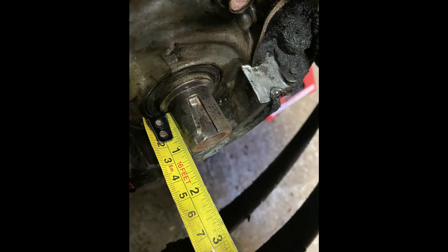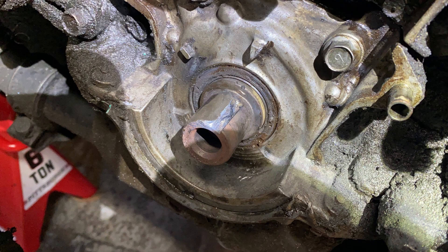I just want to show a picture of what the crank looked like right when I got it, when I took it apart. Starting by fixing this — I had nothing really to lose — so I put a weld right on the left side, left keyway, to build up that edge. With my TIG welder I laid a nice bead of steel. I used the crank gear, the timing gear, to grind the outer diameter with a die grinder and sanding disc, getting it to the perfect diameter where it'd slip over. Then I used my Dremel to cut that keyway.